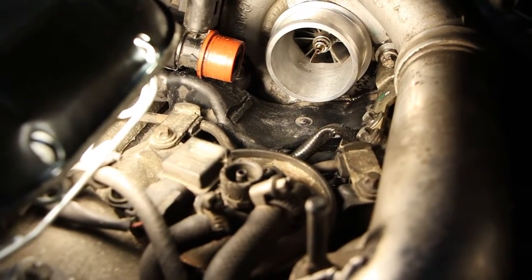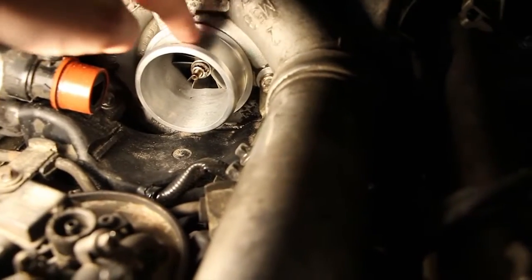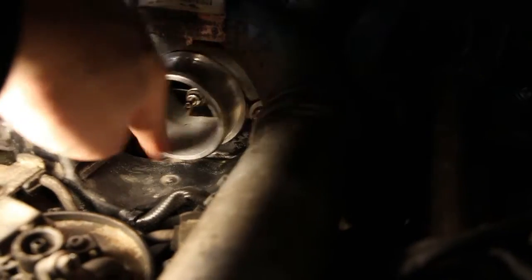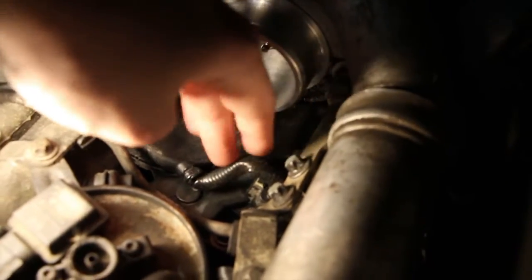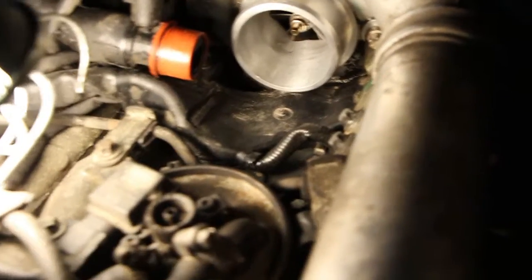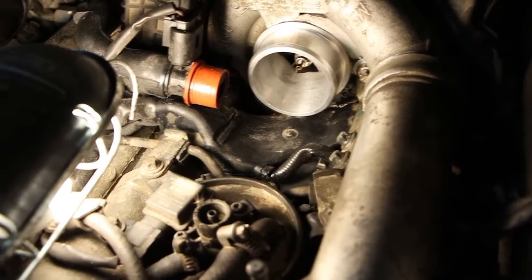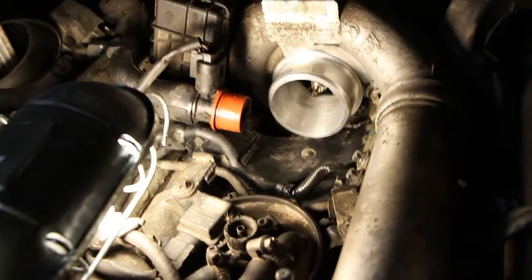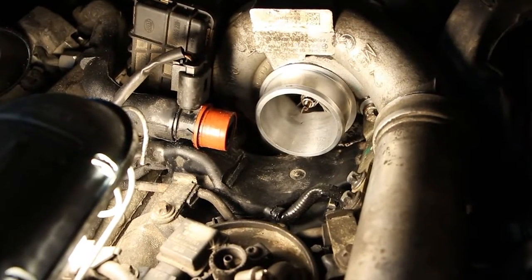If you're going to have this area opened up, you might as well clean it out. Usually when this seal goes bad, a little bit of oil can leak out and sort of coat the harness here and find its way down to the swirl motor, which is right there. So if you've got some of that leftover carb cleaner or whatever you're using, just use it liberally and clean this area out. You don't want it to mess with the swirl motor and potentially damage it. Once you've got it nice and clean, then you can put everything back together.